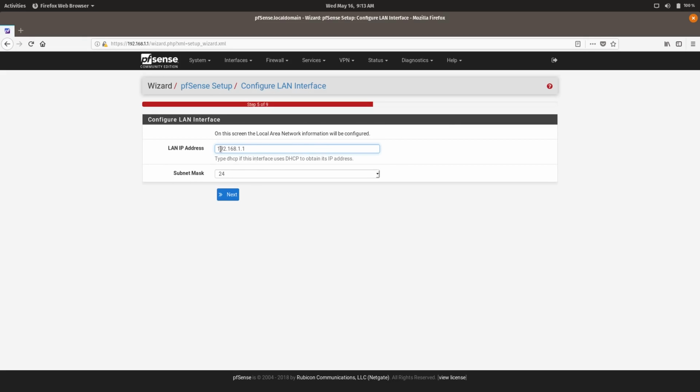This is where you can customize the LAN IP address for purposes of this demonstration. We're going to leave it at 192.168.1.1, but if you're going to set up VPNs and things like that, a side note is you may want to choose a different address. And the reason for this is if two networks, the one you want to get to and your network, happen to have the same range, you're going to have problems because you suddenly have a competition. If I have 192.168.1.10 as a device I want to get to over a VPN, and my network has something at that same address, you then have to play with the routing to make sure which one of those you actually want to get to when you're connected to the VPN. So you may want to assign something other than this, but that kind of depends. Don't assign it the same as your corporate network that you want to connect to or whatever network, because that would then cause a problem. So this is just some thoughts on assignment.